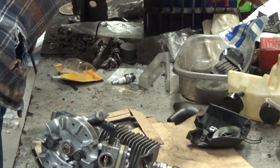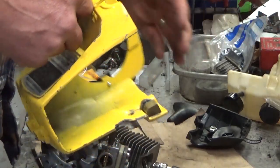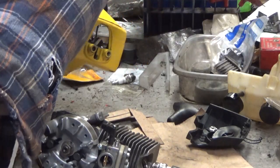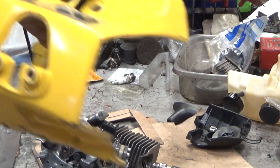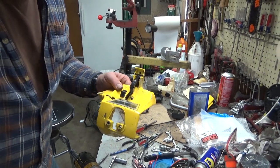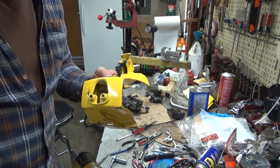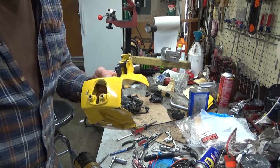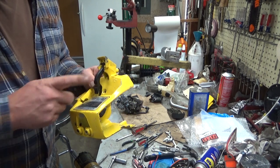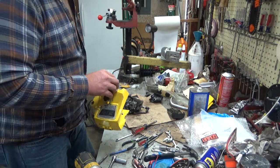The only other thing I've done since diagnosing that condenser as bad was get the trigger and spring back into this thing. And there's no magic to that. You just have to get the spring looped down around the tang and through the trigger. And you will fail a couple times, and it's just a pain in the neck. You actually don't need to take this loose unless the trigger is broken. You can get the whole case apart without it.